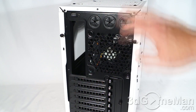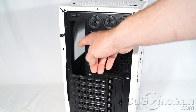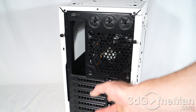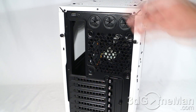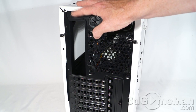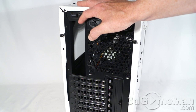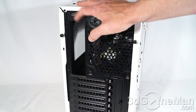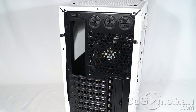Note their logo at the back. They include three rubber grommeted holes for water cooling tubes and/or cables to pass through, as well as a 140 millimeter exhaust fan. Here's where the motherboard's I/O shield plate gets installed, and they include seven ventilated expansion slots. Each one of these has a thumb screw on it so you can very easily install and remove cards. At the top left here you've got a security loop — you can take this off from the inside, then put your cables through it like your mouse or keyboard cables so they'll be secure, especially good if you're at a LAN party.